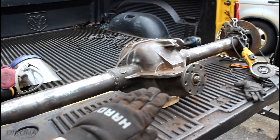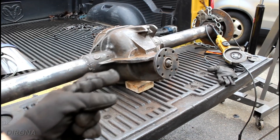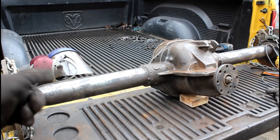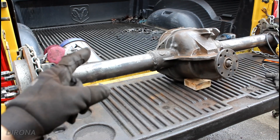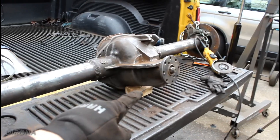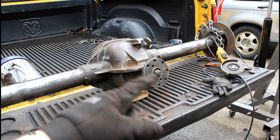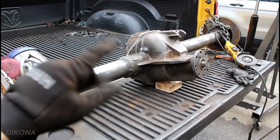The next thing I did was tilt up the pinion to get to the angle that I would like to install this thing at, and that's based off of the pinion angle of the axle that's in the Jeep right now. I already put some adjustable upper control arms in the Jeep, and I tilted the pinion on the existing Dana 35 to get to the angle that lined up well with the driveshaft and the transfer case. It turned out to be about 15 degrees in my particular case. So right now I have this tilted up at 15 degrees with that wood block right there — super high-tech, but I think it'll work. I'll just periodically check to make sure that this is at 15 degrees, and then everything else we install will install level.